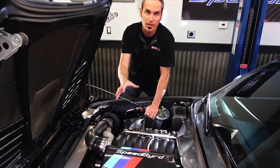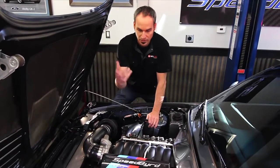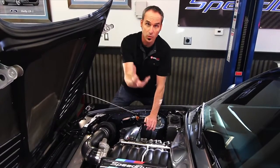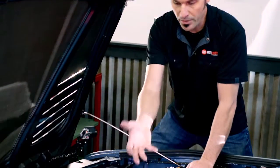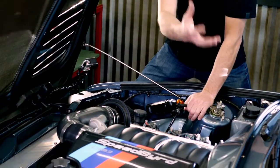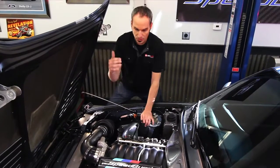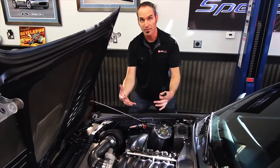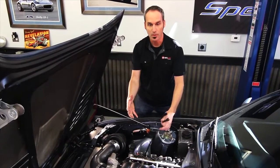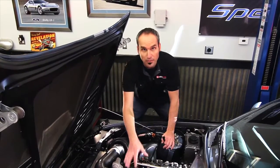In small doses that's okay, but in large doses from racing, you end up coking valves and getting a lot of carbon deposits. One of the worst things is that oil is a low-octane fuel — you can burn it. So it mixes with your premium gas or race gas, and now you've got low-octane when you combine them. With all the spark in there, you can start knocking, you can get a pre-ignition event, and you can pop a motor. So what you really want to do is filter that oil out before it gets ingested into your intake manifold.